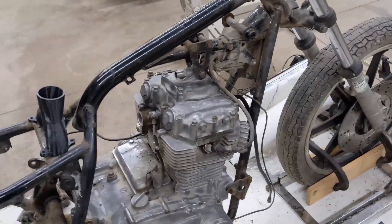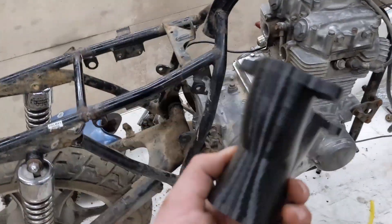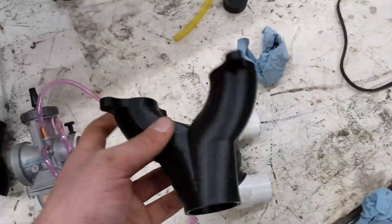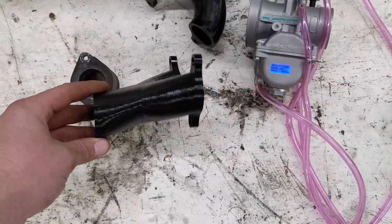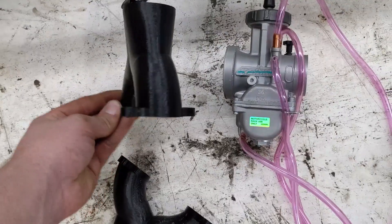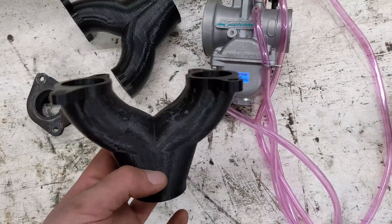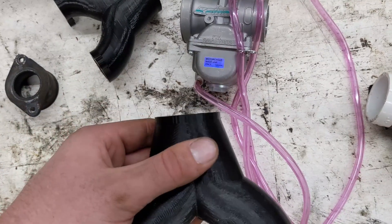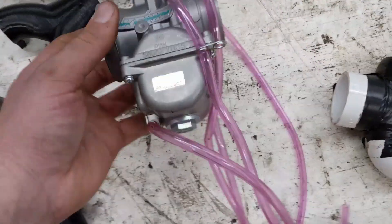My main problem right now is I need to split that one carburetor into two, so I've been making prototype intakes. The first one didn't work, so I chucked it. Version two is a little swept down, while this one is straight out — I just 3D modeled it real quick and printed it out. Hopefully it bolts up and I can slip a pipe over it, but it needs to be a little taller, so I'll adjust it. That's so this carburetor can go vroom vroom on this bike.